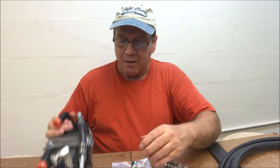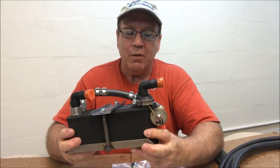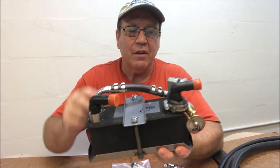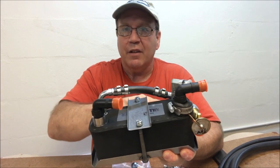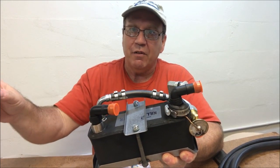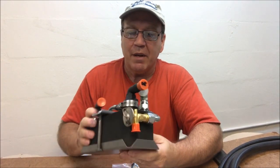Now, here's the main thing with the kit. This is the KC system. Basically there's a little evaporator core inside this little device. What it does is it accepts the Freon from your AC compressor. It cools the evaporator core. Your intercooler fluid flows through this, gets cooled, and then is sent over to your intercooler by your blower and drops your IATs quite a bit.